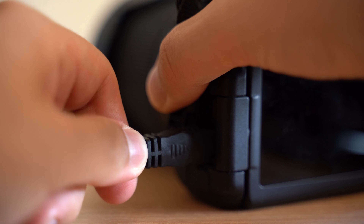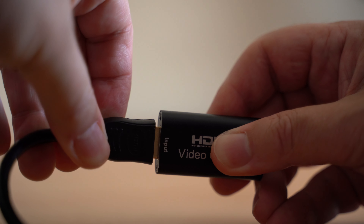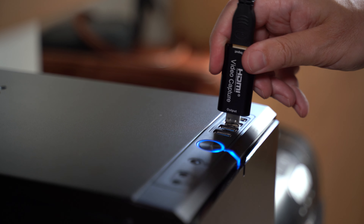Using the capture device is very simple. Use the HDMI cable to connect to the camera and then to the capture device. Connect the capture device to your computer and Windows 10 will recognise the capture card and the camera and set it up with all the correct drivers with no real problems. Then your camera is ready for your chosen software. Here I've set it up with Zoom, with a comparison of the webcam versus the digital camera using the HDMI capture device. The webcam has little by way of controls to alter the blue-white appearance or to change the angle of view, whereas the digital camera excels in both by allowing changes of the white balance and colour temperature, and with a zoom lens to change the angle of view.